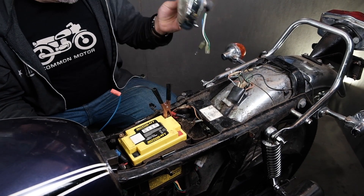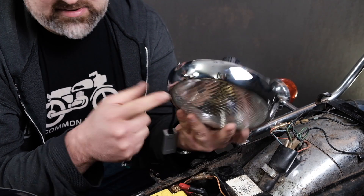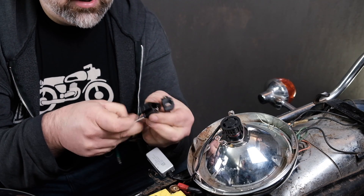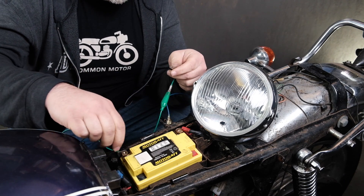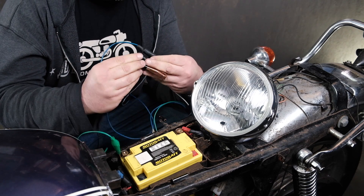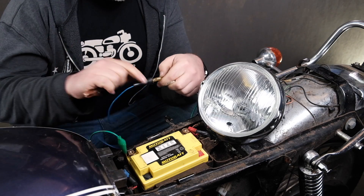While we're up here, we're going to test a slightly different style headlight. I have one of our replacement lenses with an LED bulb installed. It's the same process but uses a slightly different connector — this pigtail-style connector is very common for headlight upgrades — but we're putting it on here to keep our wire color codes the same. I'll connect ground to green to keep things coordinated, hook up to the low beam wire, and touch it to the positive side of the battery. It works just great. Same thing on the high beam side — bulb is good.